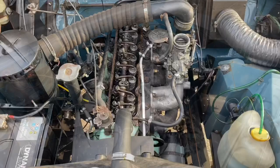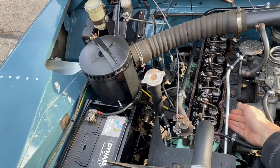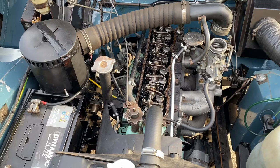The valves are reset. It didn't take me that long, actually — maybe ten minutes or so. The engine is still at a good operating temperature, still pretty warm. A couple of the valves needed resetting. What I'm going to do now is run the engine with the rocker cover off and do the three-foot hose listening test to see if I can hear any of them clacking again.